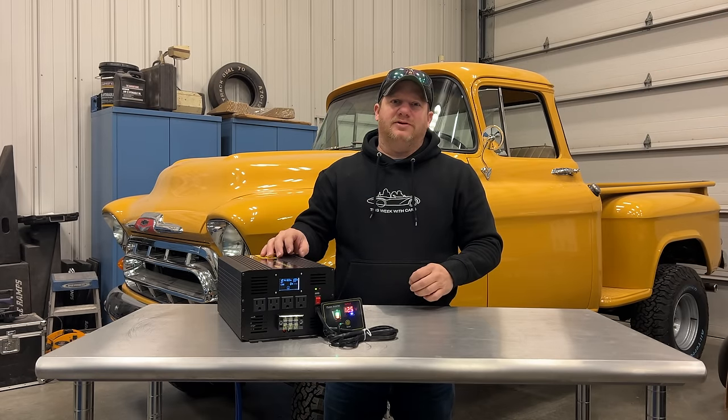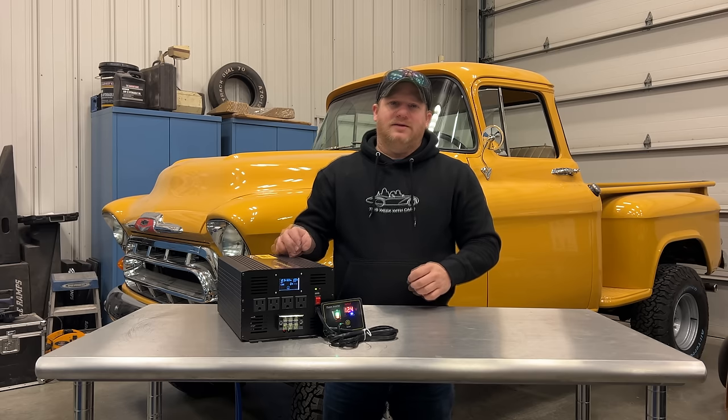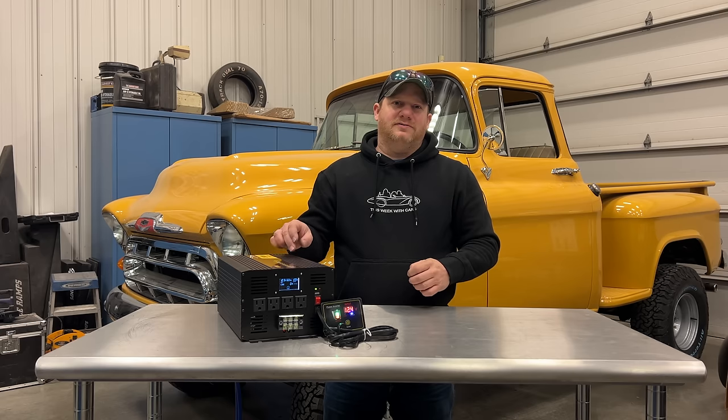What I just demonstrated is this inverter requires a lot of power. If you were to power this at full capacity non-stop, you would need an alternator of at least 300 amps. 300 or greater amp alternators are available from Summit Racing — you can even go up to 400 amps with one of their dual alternator kits. But when you're using something like this, you usually are using only a fraction of its capacity, and in an emergency something like this might be really nice to have. Devices with electric motors usually require a lot of current just to start up but use less once running, so having a larger inverter lets you start those devices.